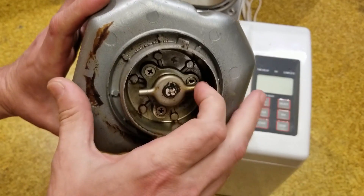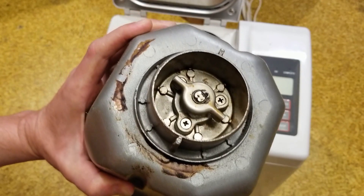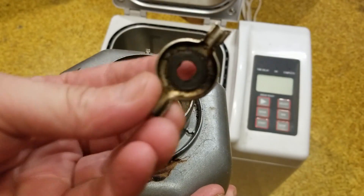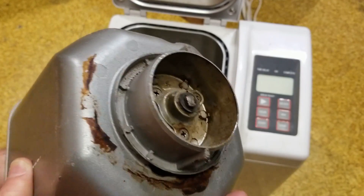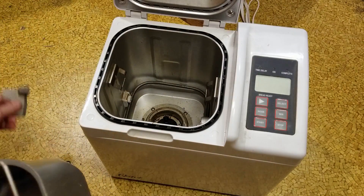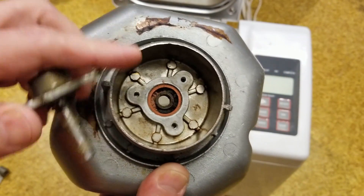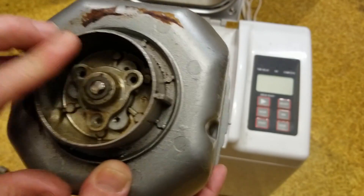This is just the cooking tray and it has a mixer. This one's actually pretty loose — barely holding in there. Let's see if we can pop that clip off. This feels like a cast aluminum piece. We've got this little thing on here which is indeed starting to wallow out, so this part was eventually going to fail and stop being able to mix bread. Popping that off, you can see they actually have an interesting system where it's sealed with a ceramic seal to take the heat and prevent particles from coming through. That's kind of interesting.